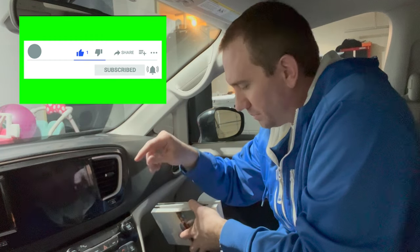So what we want to do instead of disconnecting the battery is to pull the fuse for the U-Connect system. Take power off it for a while — that will allow it to reset. Put the fuse back in and you should be good to go.